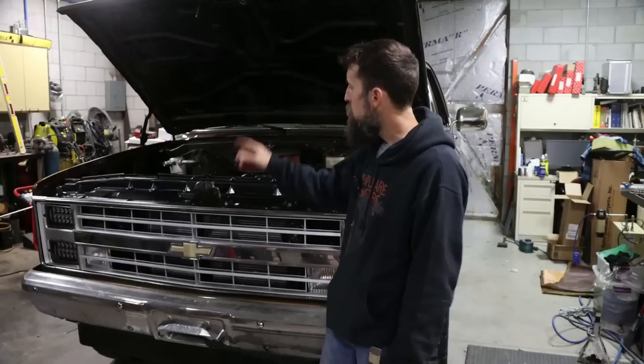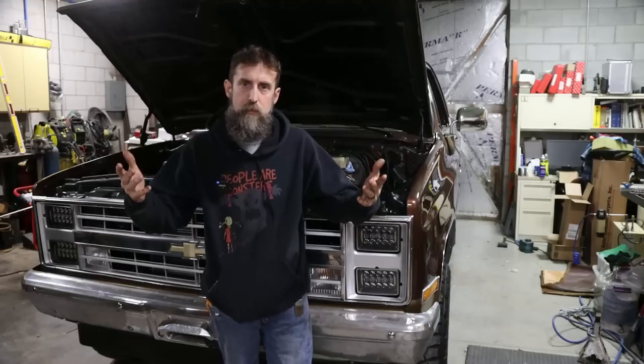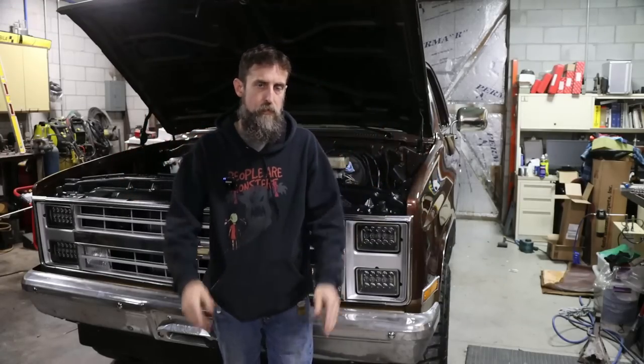We drove a while. Tested the front axle. Works good now. And every so often, I'm going to just engage the front axle and drive it in front-wheel drive till I get a few miles on this front axle and get it kind of worn in, because it's new as well. Ring and pinion, all of it's all new.